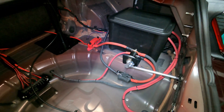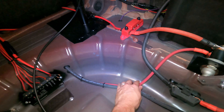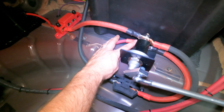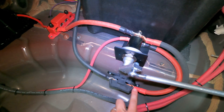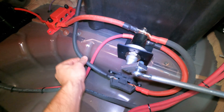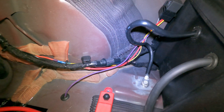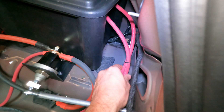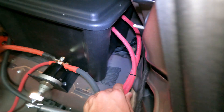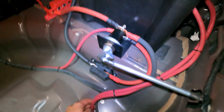The way it is wired, I have a lead that comes directly from the alternator to the bottom side of the switch, which is the exact same connection point that the battery comes from. The battery runs through this 250-amp fuse — this goes straight to the battery. The battery is grounded just right here, clear to spot, so it comes out of the battery box and that's where it is directly grounded. The lines that feed to the battery down to those jump posts are remote terminals that come out on this side of the box and then down through the spare tire well.